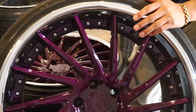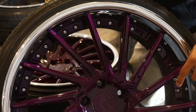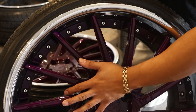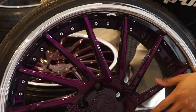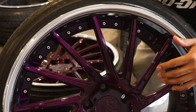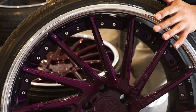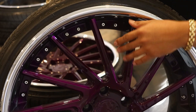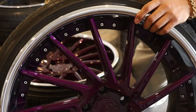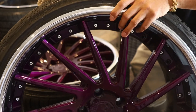Alright guys, as you guys can see, this wheel right here has all these bolts and it comes with nuts and bolts on the back. The nuts hold them and pretty much fasten them together — it's what holds this face to the lip and to the rear barrel. So we're going to start taking these apart. These are M8, and I've just been using an 8mm socket. I try it by hand first on the rear to take the nut off, and then if it doesn't work I just give it a little extra push with the gun. Let's get started.